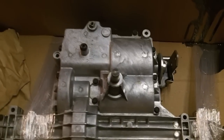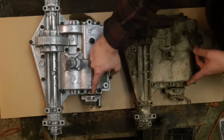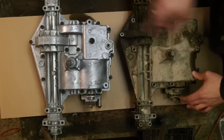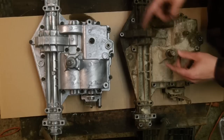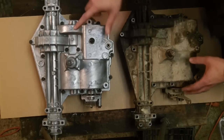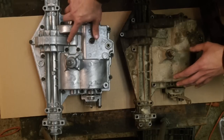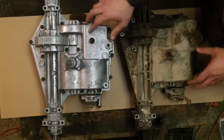Pretty much if you look between the two, they're about the same. Brakes are in the same location, though this has a different type of brake, so we'll need to swap over the one I use on the Craftsman. The input shaft key is missing on the new one, so make sure to swap that over. As far as detent ball and shifter, they both look about the same. One notable thing — these bolts are on top, and if you've seen my other videos, I point out that these are usually underneath most MSTs. I don't know whether that's an MST-203 thing or a revision making this a newer model.